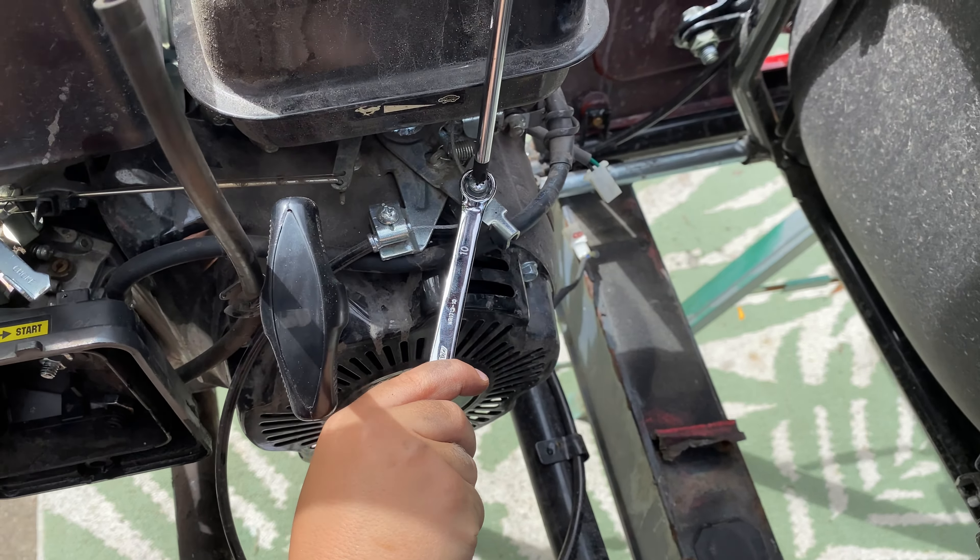Here's the Ghost engine sitting in the frame. I'll explain why I used an adapter plate rather than just bolting it down. You can get two bolts in the back just fine, but to get the engine to sit where you need it the front mounting points hang off the existing plate. You could make something yourself, but it seemed easy enough to buy this adapter for $40. It sits right on top and gives you the extra distance you need, plus a ton of adjustability — you can slide everything forward, back, left, and right — making chain alignment and tightening a lot easier.